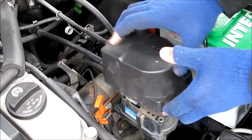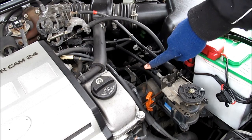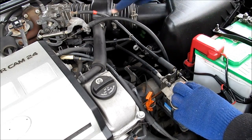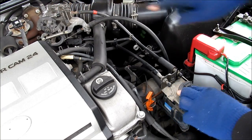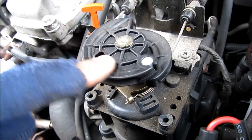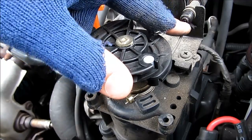If I pop off the cover and have a closer look inside the actuator, this is the cable that comes from the gas pedal inside the car. As you can see, when I hit the gas it actuates this other cable here, which opens the butterfly valve on the throttle body causing the car to accelerate. You can see the top primary plate from the gas pedal controls the secondary plate which goes to the throttle.